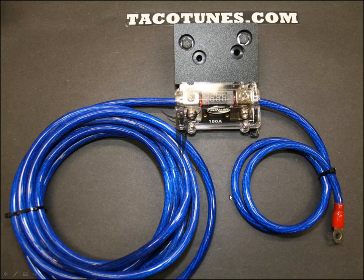First thing is 20 foot of 4-gauge wiring. Alpine has a minimum of 6-gauge, but they recommend 4-gauge. So this is 4-gauge Tsunami cabling. This is their higher end stuff. This isn't the low end stuff that you're going to find in a lot of those bundled amp kits. We've pre-crimped them for you, and then we've even cut it at the right length.